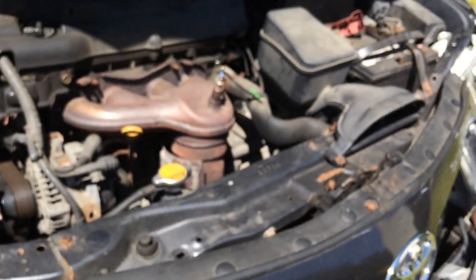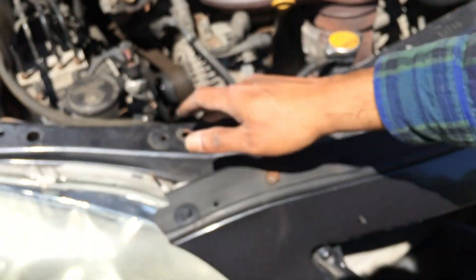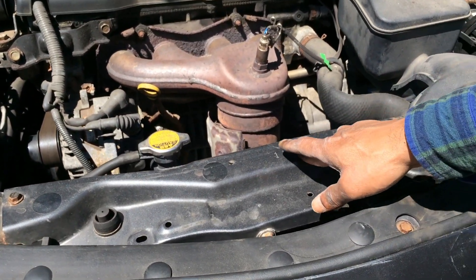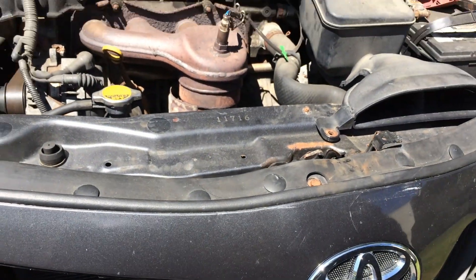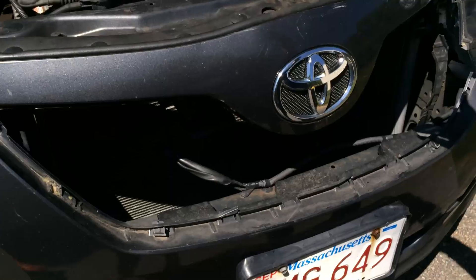We're short a couple of clips — maybe three or four — we'll just get them and put them in. Otherwise we're done with the hood. All we need to do is sand it and paint it and that'll be another video. Next we're going to start taking out the front end and unbend it. I couldn't find this part locally so the other side has most of the damage — we're going to unbend that. We have a new radiator support we're going to put in, and once that's done we'll be straight enough to put the lights in, then the bumper back.